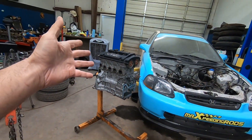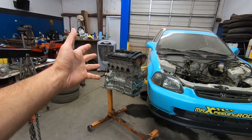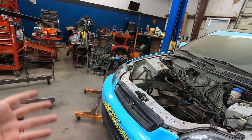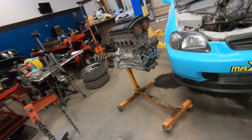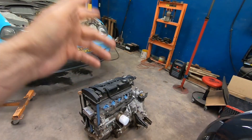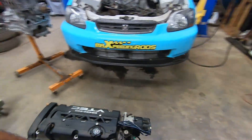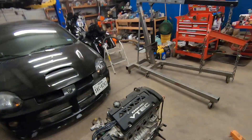It was an H2B swap as well, so you may be asking what my goals are for this. My goal is to hopefully rebuild this and have a built engine, and more than likely it'll find its place in the Prelude. To have a built H22 is not a bad thing, right? To do it on a budget is a great thing. And as long as it works out with this crankshaft, it should work out pretty well. I'm very optimistic because it's only one year that they have the 50mm crank in the H22A4, and I'm hoping this is going to be in my favor.